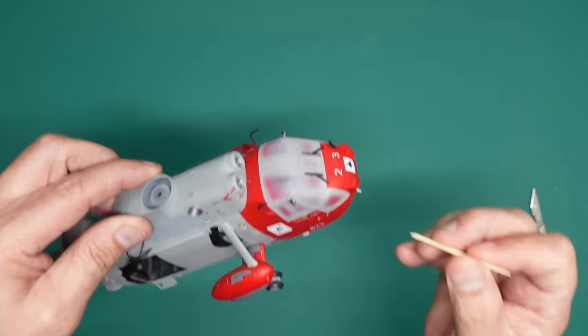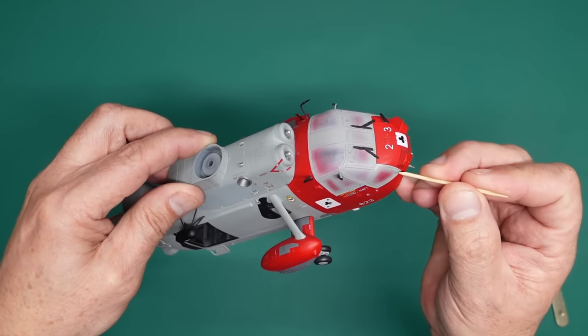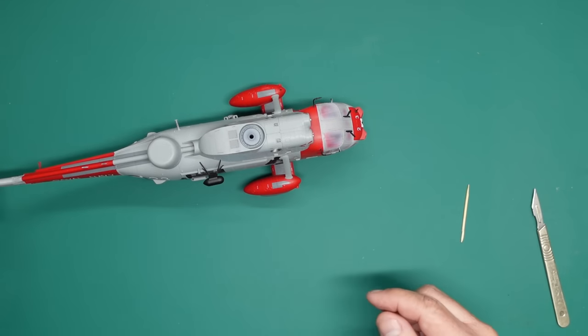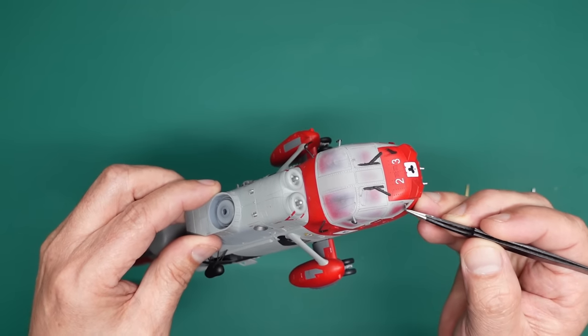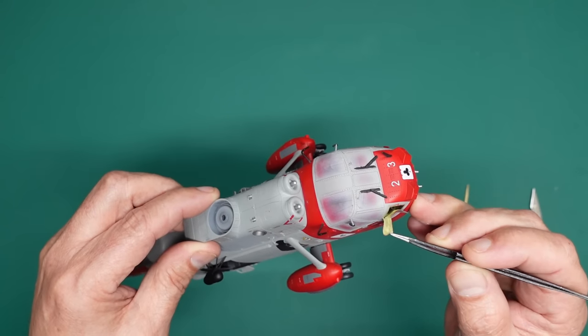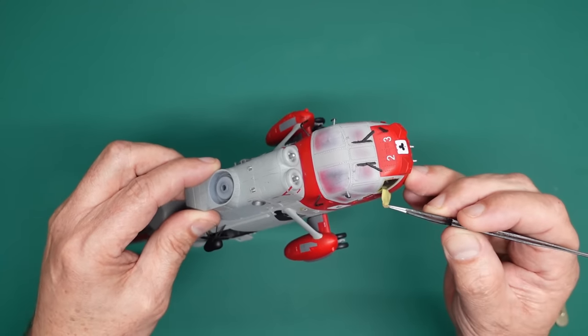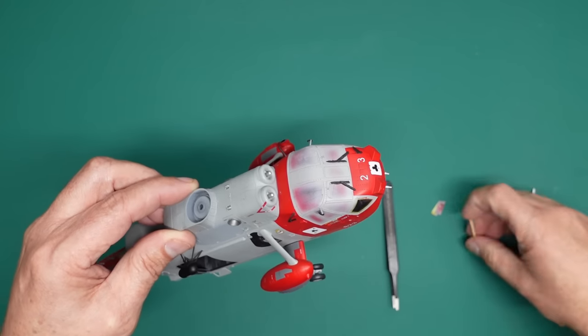So I'm going to do this on camera because everybody loves to see an unmasking. So we've got our actually large piece of masking tape there. If we do have any overspray in here, I'll come in afterwards with a cotton bud and some leveling thinners and remove it. Because remember, we tinted this, but we tinted it all on the inside. So that's okay. So that's looking good.